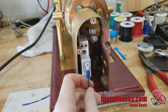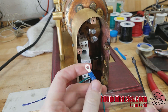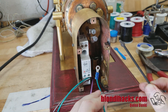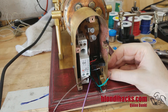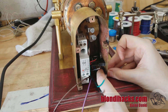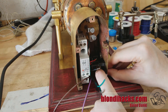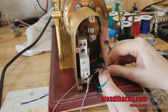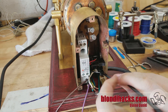Again, every single metal part here is separately grounded, because we've got a high voltage heating element in a pool of water and everything is metal. So safety is very important. This is the grommet that's going to protect the incoming mains cord from the sharp edges on the metal box. So we stuff that into the hole and then feed our mains cable through it. The outer insulation layer of that is secured with a zip tie for strain relief.